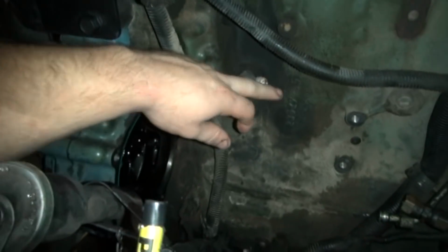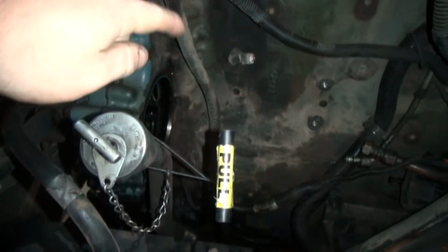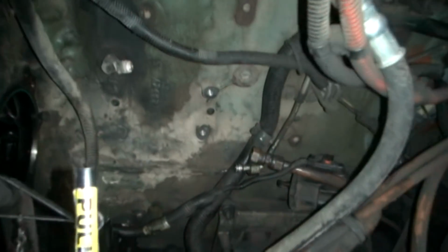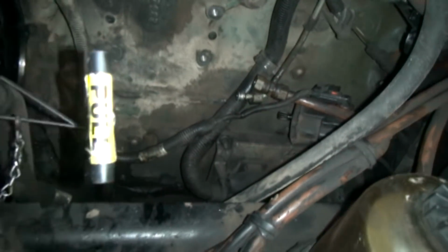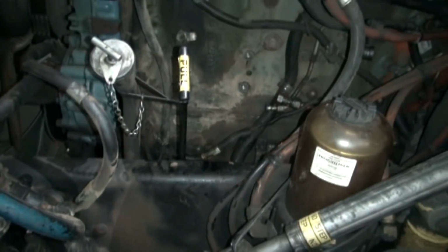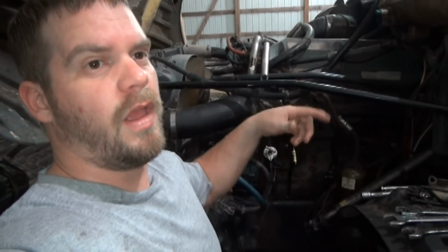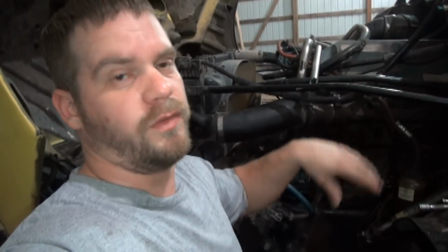There's one coolant line here. It goes here to the compressor head. One goes to the other side, goes up under the motor and goes over here. That's the fuel pump that mounts on the back of the compressor there. That compressor, when I pulled it off, you could just freewheel. It's supposed to be that you can feel it making compression on the compression stroke, and it just freewheels. You can spin it with your finger.